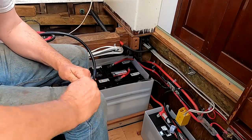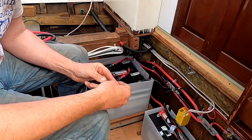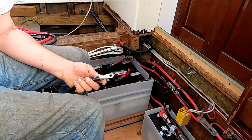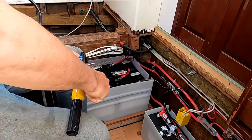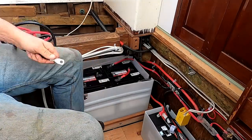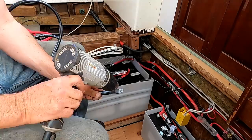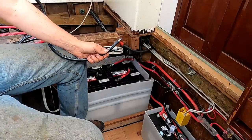I'm just down to the last few interconnects in the batteries. For the interconnects I'm using single-aught — in other words, good for 150 amps, which is plenty. My little crimping tool — I love this thing. We'll crimp these up. That is a nice, nice connection. Let's get some shrink tube on that. We'll let that cool a bit, then we'll measure in place for the length of it.